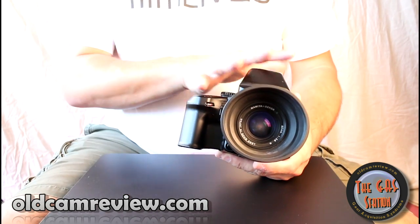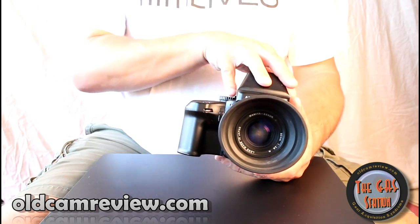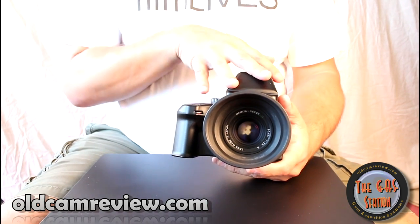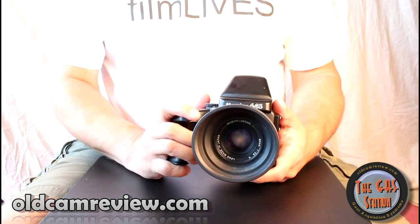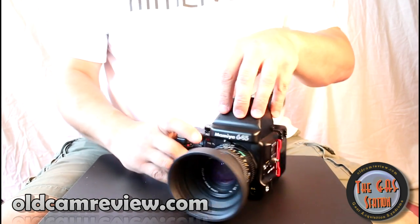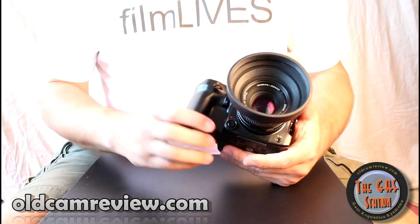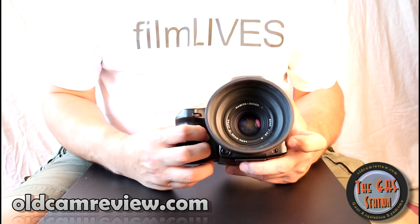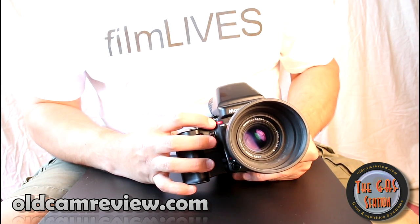There's an on-off switch here. This is basically what they call the SV kit — I'm assuming that's Super Value Kit. It's a lower-end finder but it's an AE finder, so it has auto-exposure. There's a light meter built into this camera that does affect what happens on the lens — sort of a program mode. That functionality comes from this viewfinder. This switch is the on-off for the shutter button and also the switch for the self-timer. The button on the bottom is the battery check, which will light up if you have good battery action.